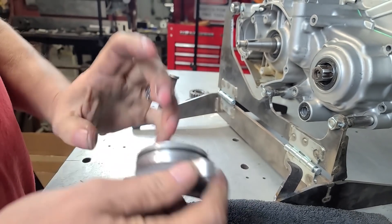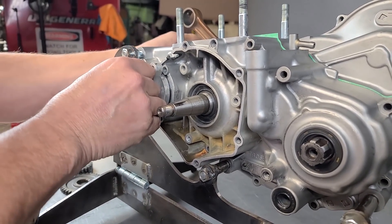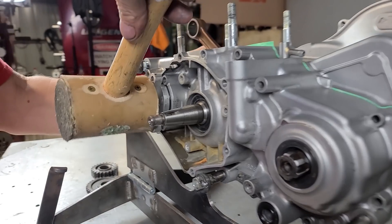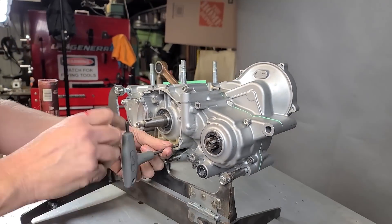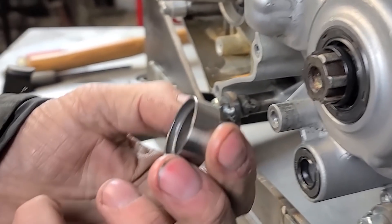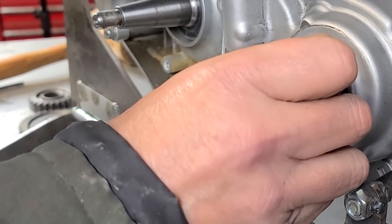Now the next thing we'll do is turn this around and put all the center case bolts into it. Putting a little bit of lube on this before you put it in there is really not a bad idea at all. That's for the counter balancer - yeah, that's the counter balancer bearing holder. This is an aftermarket one. Next thing I'm going to do is put on this flattened o-ring right here, and then take this - I think this looks like it was made by Gil Durbin. Yes - he makes awesome collars and stuff, he's a great resource for that. So that's set in place.